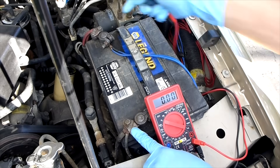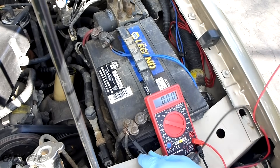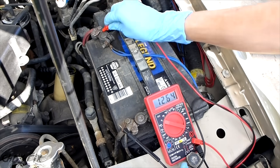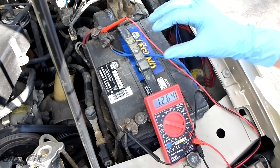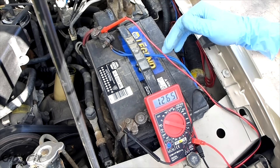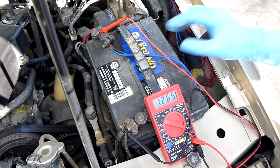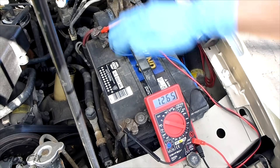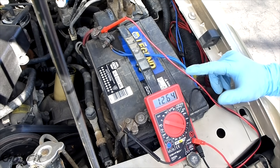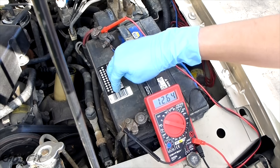Here's the negative terminal and the positive terminal on the battery. You want to make sure these terminals are clean so that you'll get a reading when you do this test. Put the black lead to the negative and red to the positive. You want 12.6 volts or something around that — it could be a little bit lower or higher, but 12.6 is the magic number. Now to see if the alternator is working properly, we have this attached and we're going to start the car. Ideally, the voltage should go between 14.2 and 14.7 volts, which means your alternator is running correctly and charging the battery.